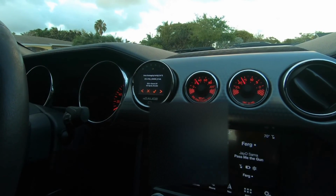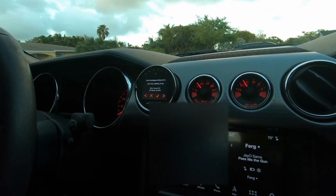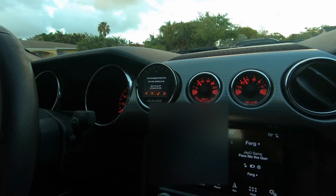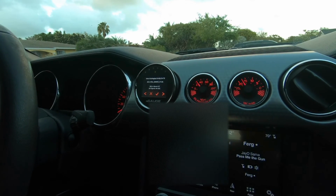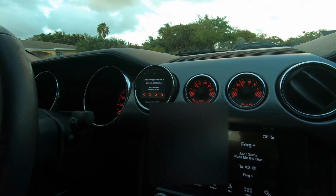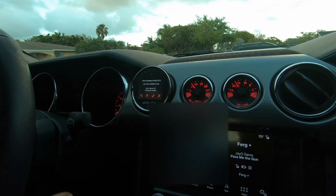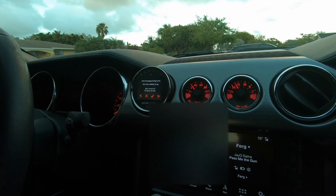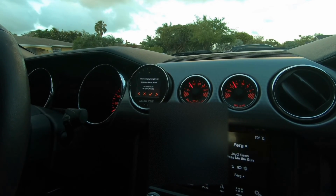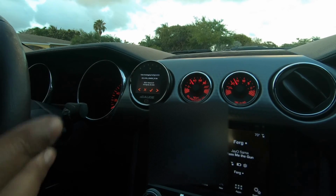The tuner wants us to get a 3 to 5 minute idle log, and then rev to 1500 RPM and hold for 10 to 15 seconds. Then do the same for 2500 and 3500. Then he wants us to keep the engine running and drive it. In second or third gear, do a couple slow RPM climbs from 2500 to 5000 RPM. And then he wants a WOT pull to 7000 RPM. And then come to a stop and let it idle for 1 or 2 minutes. So we got to do all that. We're going to get it done. We'll come back to y'all when we're about to do the pull and let y'all know how it feels.